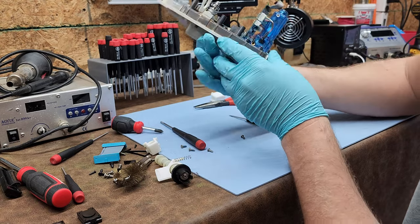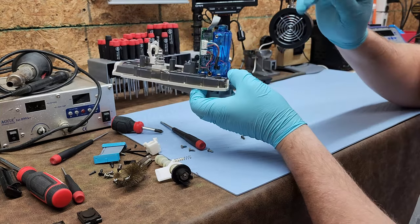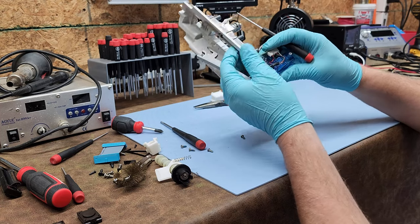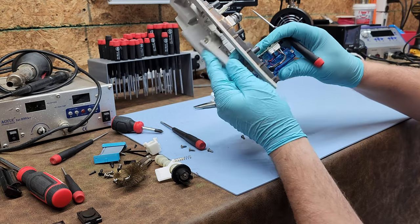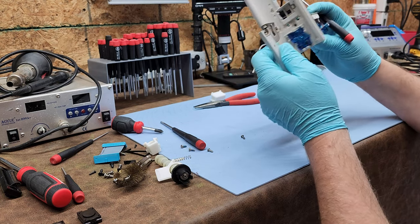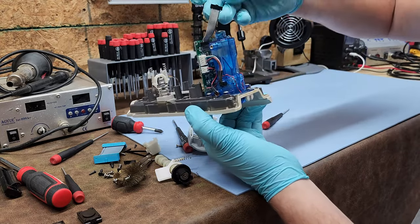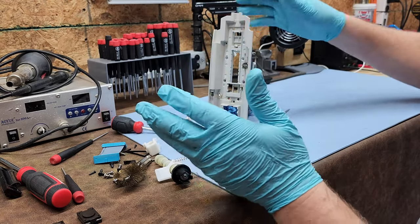That's why it's essential to adjust the angle of attack on this pawl — they got away from that with the new revisions, but on this original version it does matter. There are a couple different sensors in here: these two right here and these two up here. It's doing bubble detection inside this, and it's also doing latch detection right there. The two upper ones are probably for bubble detect. There's a lot of stuff going on right here, and it's all through this little interface board and this tiny, tiny ribbon cable. Very cool.